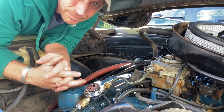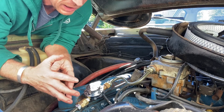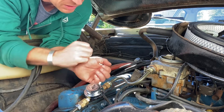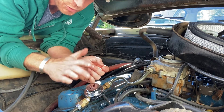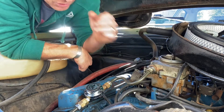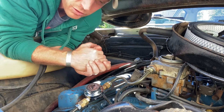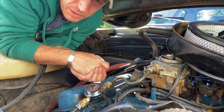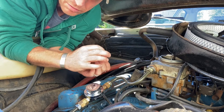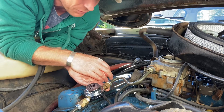That ends the tour of the brand new fuel line. We shouldn't vapor lock — we've got plenty of air gap between all the hot surfaces. The only thing left to do is make a bracket to hold this off, since there's a lot of space and I don't need it vibrating anything loose. The fuel pressure regulator is installed and that's it. So just to recap: if you know your carburetor is good, float settings good, needle and seat good, nothing's sticking, and you've put a mechanical fuel pump on it recently, odds are it's putting out too much pressure. You can keep going to the parts store getting different fuel pumps hoping one puts out less pressure, or you can get an adjustable fuel pressure regulator, install it in line, and dial the pressure back to where your car runs best.